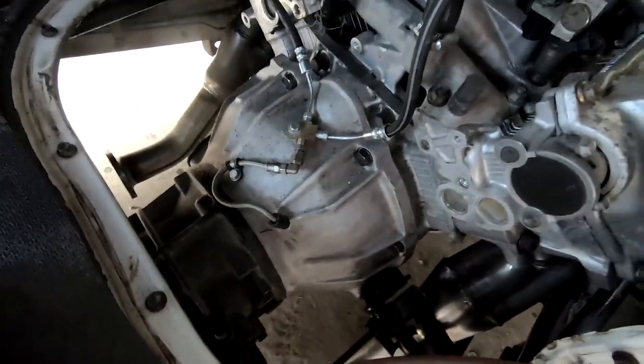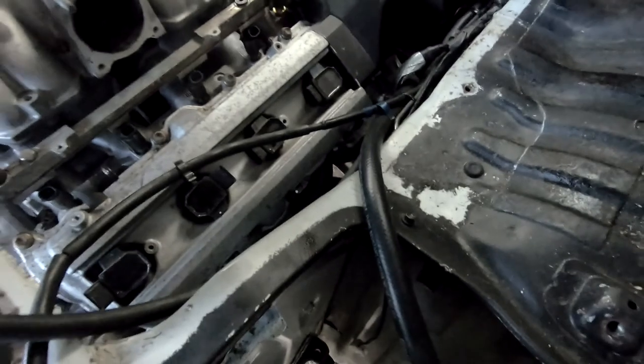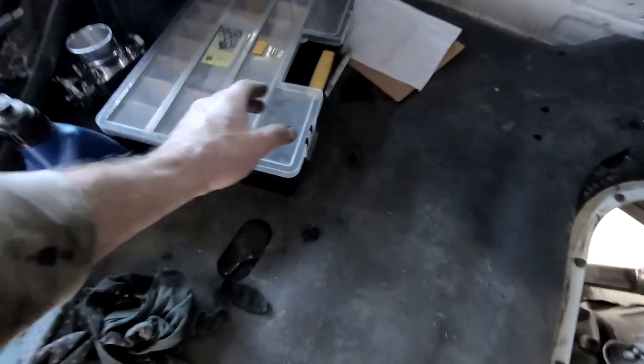Inside, the hydraulic clutch is all bled up and ready to go. We put some heater hoses in and tucked them in. We get to put the intake in — it's going to be nicknamed the gonzo tube — and there's the air filter to go in, pipes to go in, a bit of beading to go around there — little bits and pieces just to make it really nice. Putting the clutch master cylinder in was high on my list of really fun things to do — not. Of course little stuff like putting the dipstick in and getting it ready. At this point it's pretty much ready for wiring, that's the next step. We've gone as far as it's practical until some wires go in, so that's for another day.